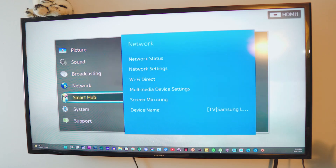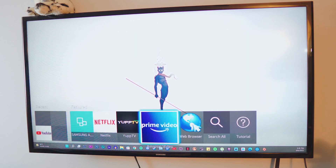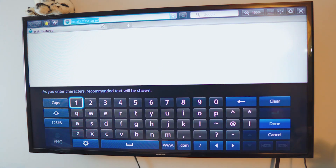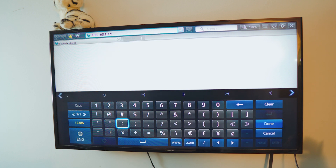We need to place that IP address into any browser — it can be a PC, TV, or whatever you like. In this case I have a browser on my old Samsung TV, so go to the Smart Hub and go to Apps, where I have a simple web browser. Open the browser, go to the address bar, and type in the IP address from the app — in my case it's 192.168.137.88, port 8088. Just type in the address as-is and press done.